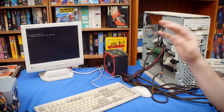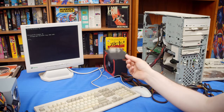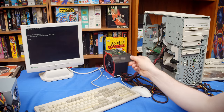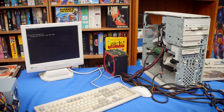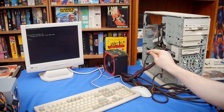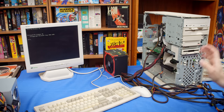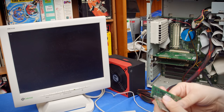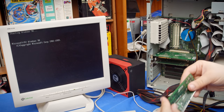Okay, I just looked. S versus NS is sound versus no sound. We have sound, so apparently the BIOS update is good. We're already at that, and version 4 is the latest one. So we don't need to do anything with this if it's good, which I don't know. I'm not even thrilled about using what's on this disk if this had bad memory, so we're not going to use that. But I will go ahead and shut it down now and put each one of those pairs in. Actually, we're just gonna put one of each stick in there. You know what, I might as well leave this in. And I'll try and deduce which one of those sticks is bad to see which configuration makes it hang on post. So it's looking like one of these sticks here is probably bad, which kind of sucks.